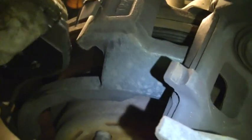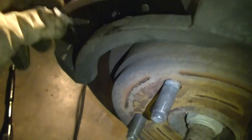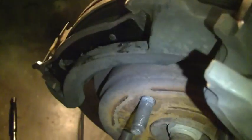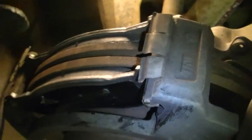Now, it's always important to make sure your brake pad side goes onto the rotor itself. Now you see the little groove here? That's what's going to match up here. I know that the brake pad deeper side is going to go in first. So it may take both hands, but I may get one of them in here just to show you. Now that side was almost in. Oh, I might have to use both hands. Now I got both new pads on, and both of the brake pads are facing the right direction.